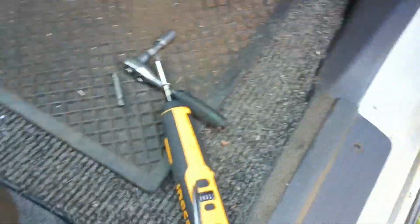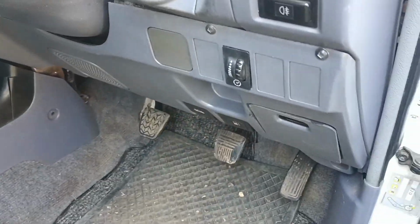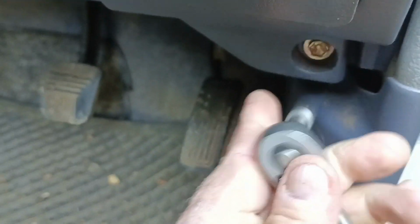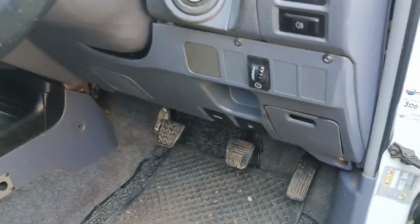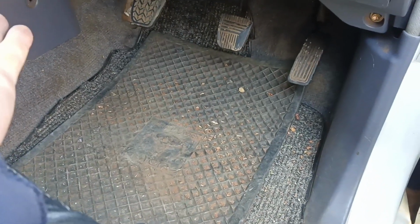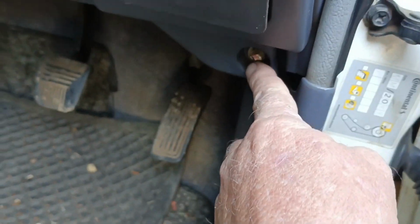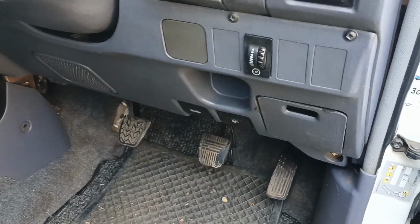We also have a Pozidriv 2 screwdriver, just to loosen them up, then this little electric one. Make sure you've got all the bits and pieces you need first, because you don't want this thing hanging off and then have to go and fetch another bit from your toolbox. So you make sure they're all here. There's only one number 10 socket here, so we've got that. I always put a little extension on, and that's it. We'll get onto the keys in a second. What we always do is loosen all the bottom fasteners first, then the top fasteners. The reason is, if you do the top fasteners first, it starts to hang. On older cars, it's going to start breaking all those bottom clips, and then you've just got more cable ties and plastic welding and crap on your dashboard, and that's the last thing you need.